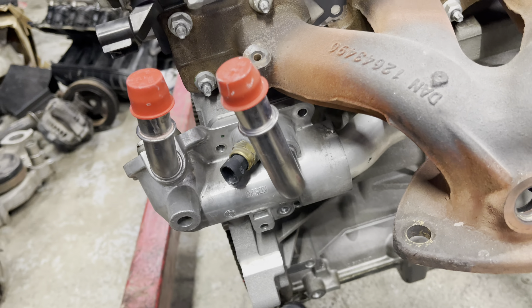Got the motor out, currently doing the motor in this GMC Terrain. There are three bolts in the thermostat housing — three 10-millimeter bolts you'll have to remove. Use a 19-millimeter socket after you unplug the sensor; you can pull that out. Then remove these two bolts and this one bolt here — that'll give you the ability to remove this housing. It might be a little stuck. It's actually called a water outlet housing.